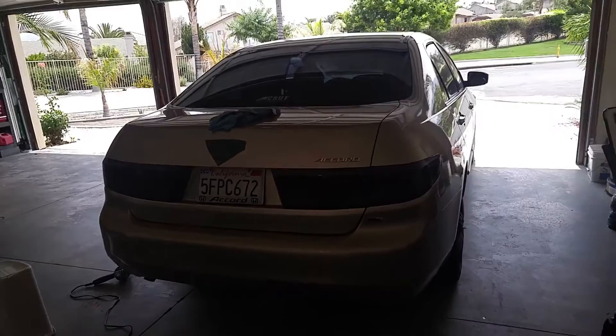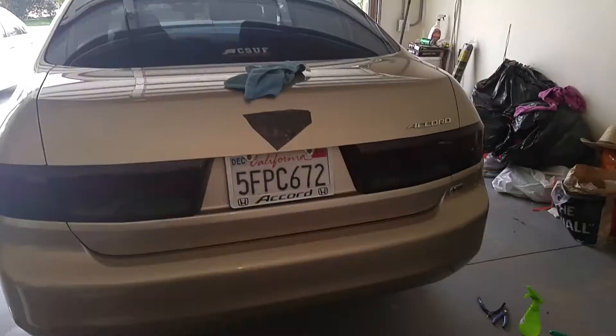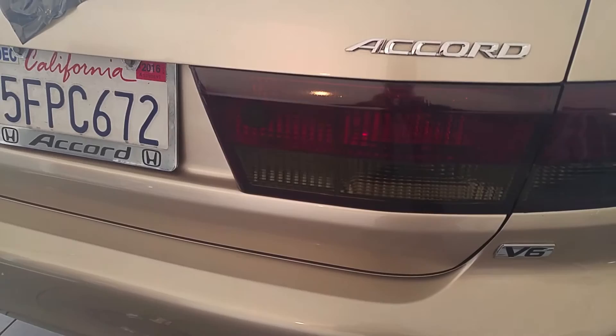So this is actually the final result. As you can see, I finally finished it up. I know I said I was going to record the whole thing of me doing it, but unfortunately my iPad just wouldn't work and it kept turning off, so I wasn't able to record the whole thing, but I did get some clips in. Anyways guys, as you can see, in my opinion it looks really good. I feel like I did a lot better job on these middle two tail lights instead of the outer edges, just because I'd never done it before. On this first attempt I was using a dull blade and I didn't spray down the inside of the tail light. The second time, with these two middle tail lights, I sprayed them down with water first and then put the vinyl wrap on top, and it made it a lot easier to get rid of those bubbles.